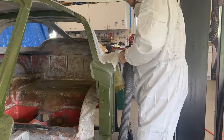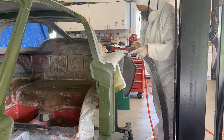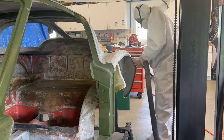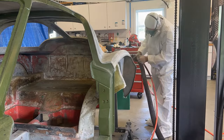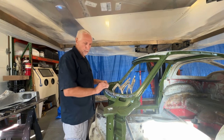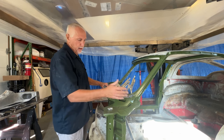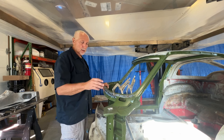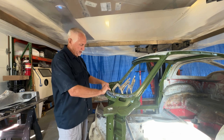Let's get started. What I'm going to do today is put these bonding strips on the lower windshield frame. I'm clamping them very tightly and going to drill for the rivets. I'm going to pull the clamps off. They say to use the 3M panel glue as a sealant and to help glue these on and rivet them.